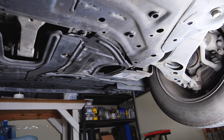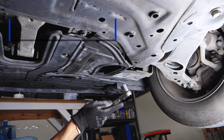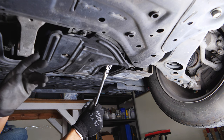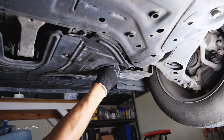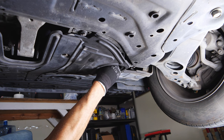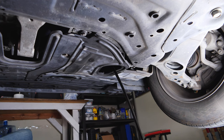So now we're going to start by removing our oil drain bolt. We're going to take our 17mm socket with our flex head ratchet, and you can use this support brace here to get a little leverage to break loose this bolt. Once it's loose, go ahead and use your hand to remove the bolt. You want to pull the bolt out pretty quickly because the oil is going to come out fast and you don't want to get oil on your hands — just toward the end of the final threads, pull it out as quick as you can.